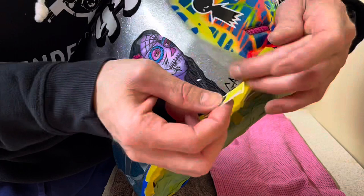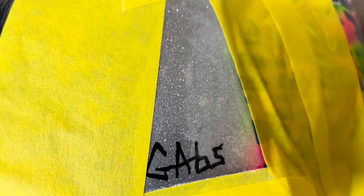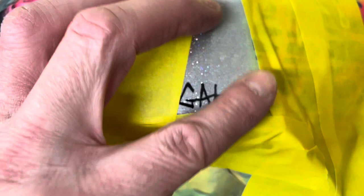All right, so we razored it. I don't know if you can see where it's dull above the B. It goes up there and then that whole area. I took it all down. Actually, I think that's going to come out really good. Note, before I did this, I already had clear under this coat of clear from the previous part. So anyway, I shaved it all down to the feel so I can't really feel it. Now I'm going to wet sand it with a block, 1000. And then we're going to go to 1500, wet sand, and then 3000, and then cut with compound and then polish. So let's see how this comes out.